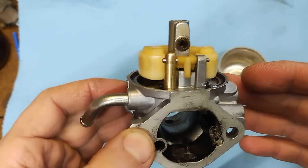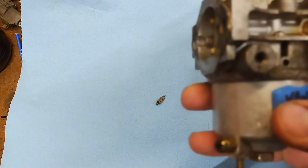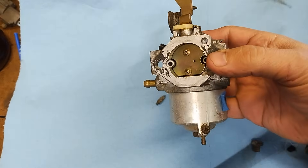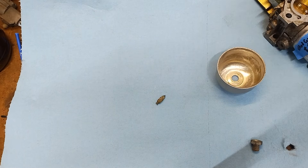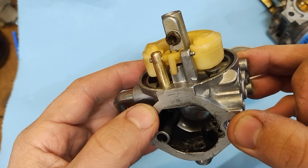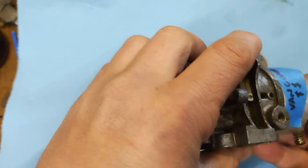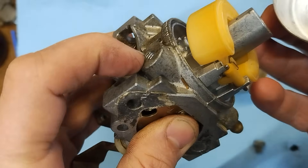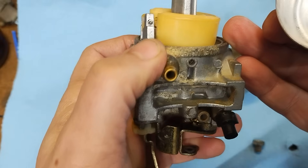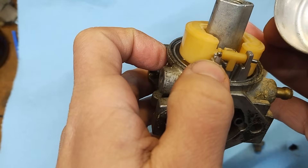I have a couple others from him — Mikunis for Briggs Vanguard engines, which he's indicated are hard to find or fix and the aftermarkets don't run the engine well. Overall I'm pretty happy with how that went. I think I'd do the repair pretty similar on the next one. We'll have to see if there are any passages in the way — these are going to be a little trickier. The fuel passage is a little closer to where these standoffs are, so maybe this one won't get milled all the way down. We'll do a smaller prosthetic on it. Maybe this will be a separate video.